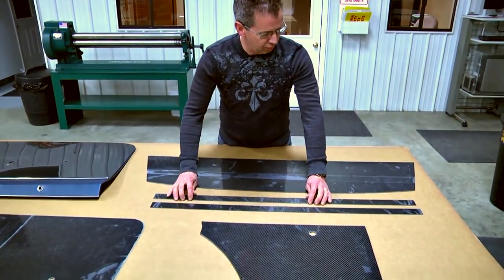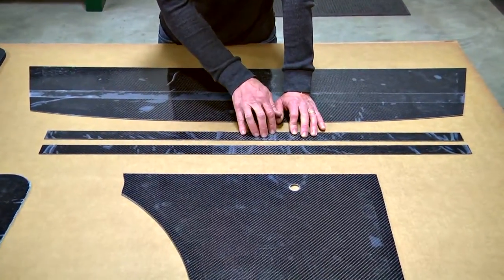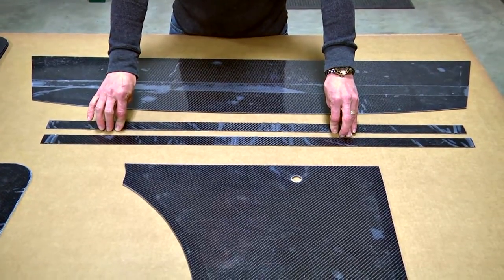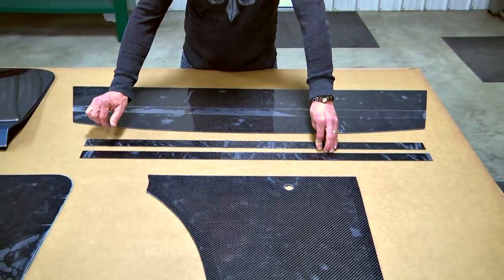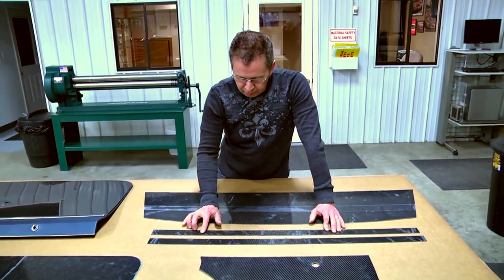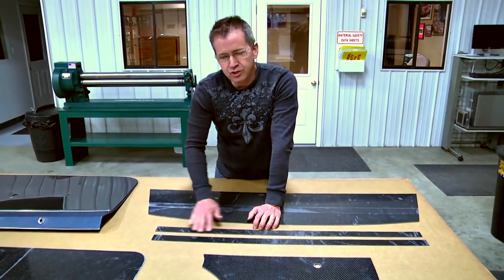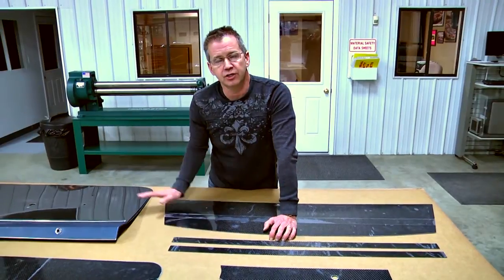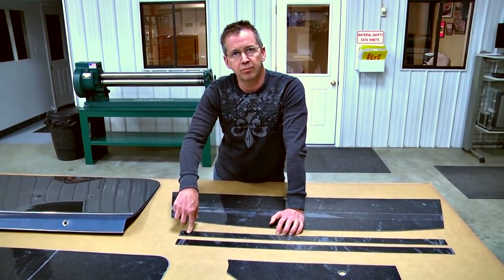The door sills are super easy to put on — they're basically like veneer covers for the stock door sill plates. Take the four screws out that retain the door sill, remove the door sill plate, lay the carbon piece right on top of it, and use that aluminum door sill as a template. Mark the holes, drill through the carbon for the screw, then take a slightly larger drill bit and slightly countersink the carbon so you can use the same screw back in place. These lay nice and flat, but since the screws are spaced fairly far apart, put a little strip of clear silicone between the screws and tape it down — that'll hold it tight to the aluminum sill and it won't buckle up. Same as with the door panel screws: don't over-tighten so that it buckles the carbon; just tighten them down snug since they fit into the steel rocker and are just holding that trim piece on.